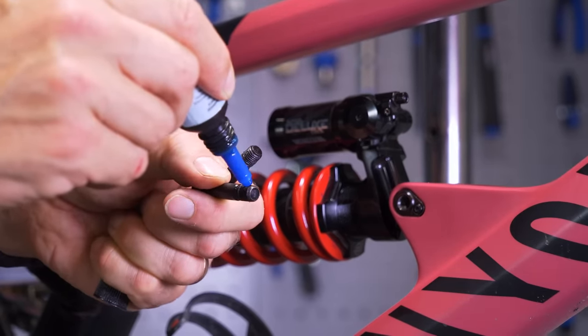There are two ways of measuring sag. The first is the old-school method: measure from the bottom of the saddle to the top of the tire, measure the bike without you on it — this one has 140 millimeters of rear wheel travel — then measure a percentage of that as your sag when you sit on the bike. On the RockShox shock we have here, there's a slight cheat: just like on air shocks, there are markings on the actual shock itself. Looking closely behind the spring, you can see markings for 40, 30, and 20% available travel.